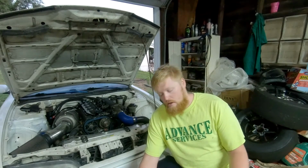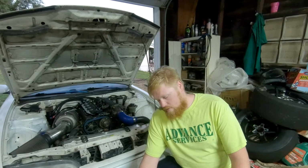My advice to you, the non-VVTI guys, I would actually advise you guys to swap the heads. The VVTI GE heads are very good. They've actually been proven to flow the best. My advice to you would be to swap that head onto your bottom end, and everything in the first half of this video applies to you from there on. Other than that, that is basically it.